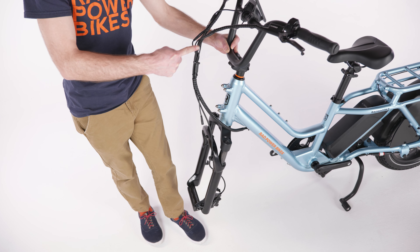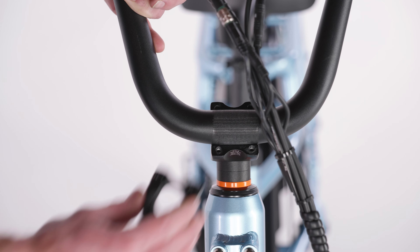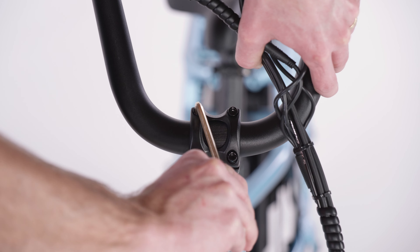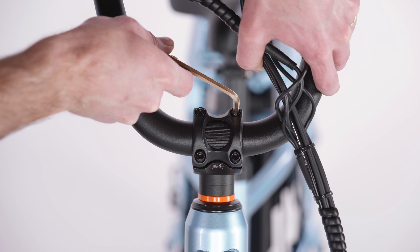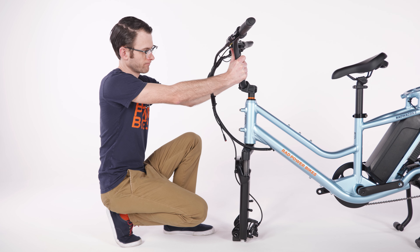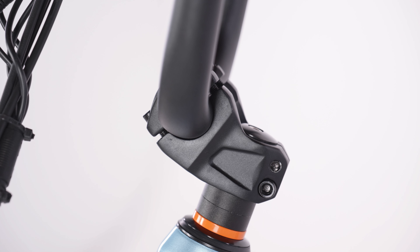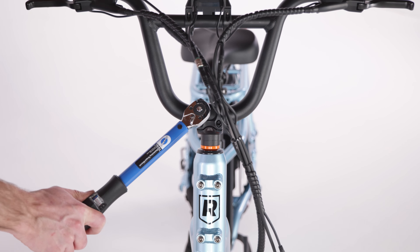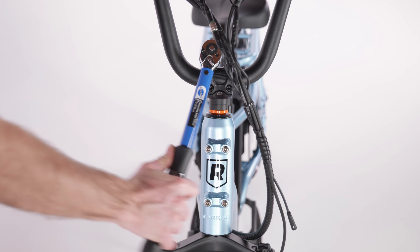Trace the brake cable on the rider's left side to ensure it runs straight down. Center the handlebar on the stem, install the four bolts by hand, and use the Allen wrench to tighten partway in an X pattern until the handlebar is just tight enough that you can adjust its angle. Adjust the handlebar so it is roughly parallel with the front fork. Ensure the gap between the faceplate and the stem is evenly spaced and the bolts are tightened evenly. Use a torque wrench to torque all four bolts in an X pattern to the value listed in your owner's manual.